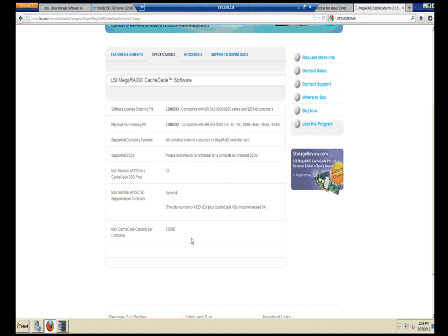And is there a limit? Just out of curiosity, is it just because of the algorithms or the way it's using the caching, to be allocated through what's hotly being used in the files? I think when you think about the resources that are allocated, as we move into the end of this year, we're moving up to the next level of our SAS 3 12 gigabit, much more powerful ROC. As we move forward, we'll be able to expand. But right now, in terms of balancing the resources of managing, you could have a hard drive array of 100 drives. Right. And so balancing all of that, it's a lot of workload.